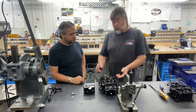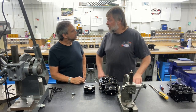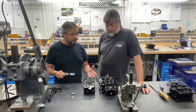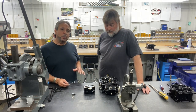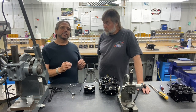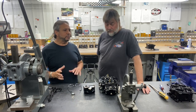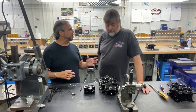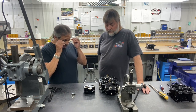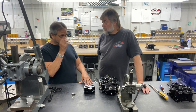When you hit this hard, fuel goes everywhere — it even splashes outside the carburetor. Also, you have to put into consideration with the accelerator pump adjustment not only the cam but the squirter — the pump shot size — which is a whole other topic. We've all thought about stumble meaning we need bigger squirters, but we'll stop there and not get into that.